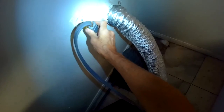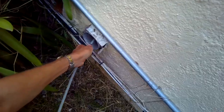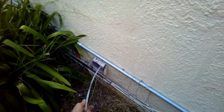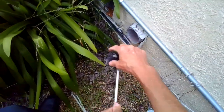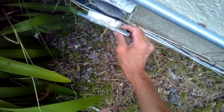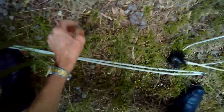These lint eater tools are about $25 to $30 and you can get them on Amazon — they come with a 12-foot extension. I put the power back in and tested it from the outside; you should feel airflow like a hair dryer in terms of volume. I wasn't getting that, so I knew there was probably more obstruction. After cleaning out with the lint eater tool — and you can buy extensions if you have more than a 12-foot span — that did the trick. We got the obstruction out and the dryer is working. Hopefully this is helpful, thanks for watching, and please subscribe.